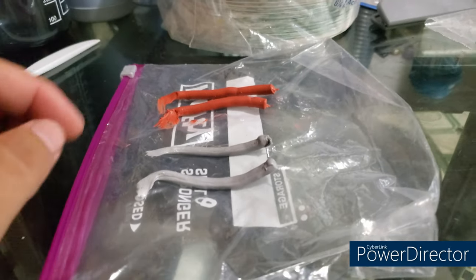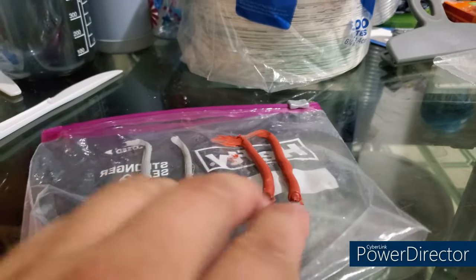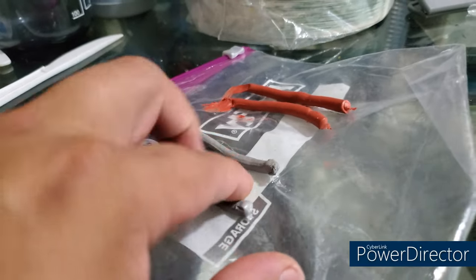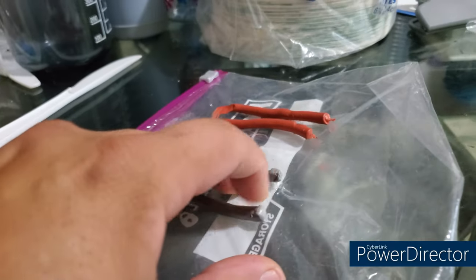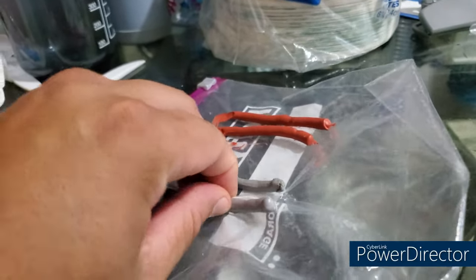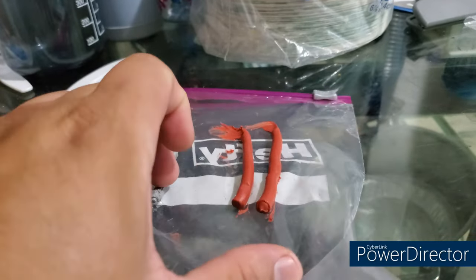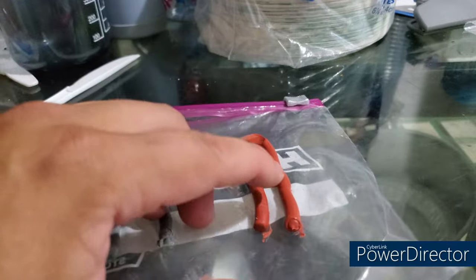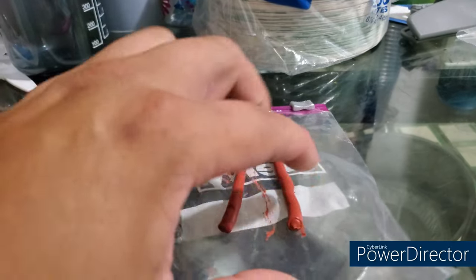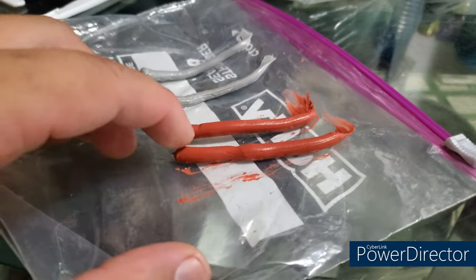It's been 24 hours exactly. You can see the two beads that we did. The Permatex is solid — this thing literally glued to the plastic, and you can feel it. It is solid. Now the FIPG is actually still tacky and has no adhesion, as you can see, to the plastic.